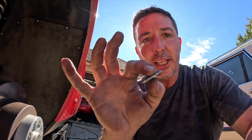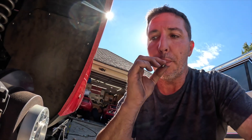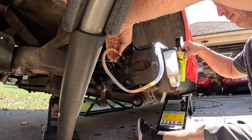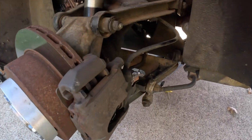I took my suction tool and sucked all the fluid out of the reservoir up front. Then I came back to the passenger rear — the farthest away — pulled the bleeder valve completely out, put it on the bench grinder, and cleaned it up. I'm doing that to all four of them, making sure everything is clean and shiny and blows through easily. Then I'll fill the reservoir, hook up the suction tool, and start pulling new fluid into the lines. It's working — I just need three hands to manage everything.